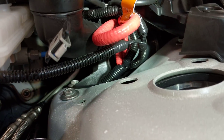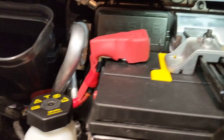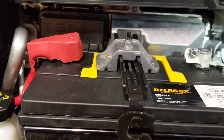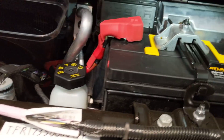Back there is the windshield wiper motor. The first responder loop is part of the wiring harness up here, so if it gets cut you either have to splice it or replace the whole harness. That silver box behind the battery is not the DC-to-DC — there's no high voltage going in there. I think this is the front power distribution and body controller. There are no fuses in the Model 3, so everything is solid state. High-current wires come out of here; it probably also monitors the battery charge current, and there is no IBS as in the Model S.